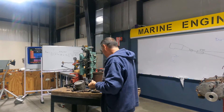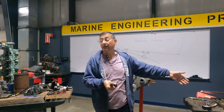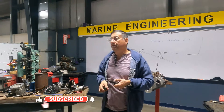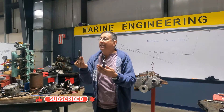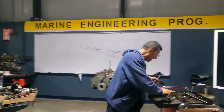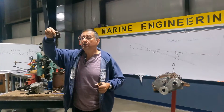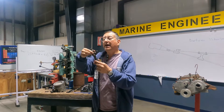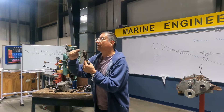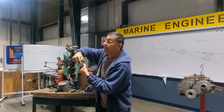In some cases, none of the tools in your set - and I have like five or six sets - will fit this particular engine. I don't have the adapter to enter the hole and check the compression. In some cases, what I do is I sacrifice one injector. I close the return port - normally the injector has a fuel input and a return. I close the return and here at the input I adapt the fitting.